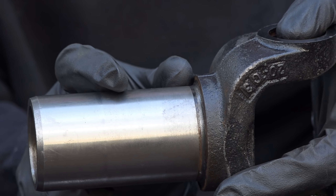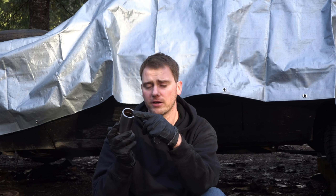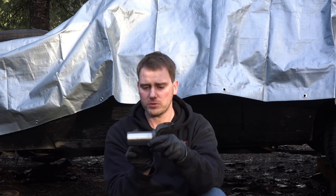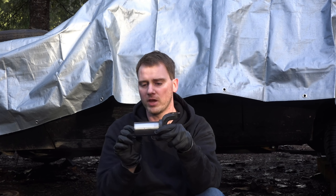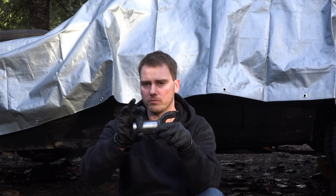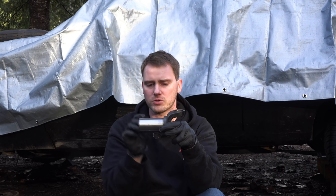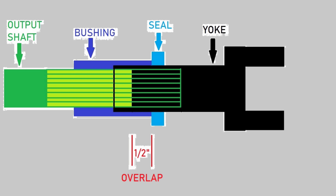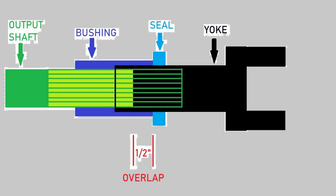The other thing I did is — if you notice on a Turbo 400 yoke, the inside of the splines are actually machined out smooth by a half an inch. So if this was sticking out an inch and a half from the tail shaft, you've got your seal riding right about here, then the bushing that rides around this to help center everything. That means we probably only had about a half an inch of yoke with the bushing on the outside and the splines on the inside — and that's probably where we were seeing the wobble, because there just wasn't a whole lot of engagement between the two holding it tight.